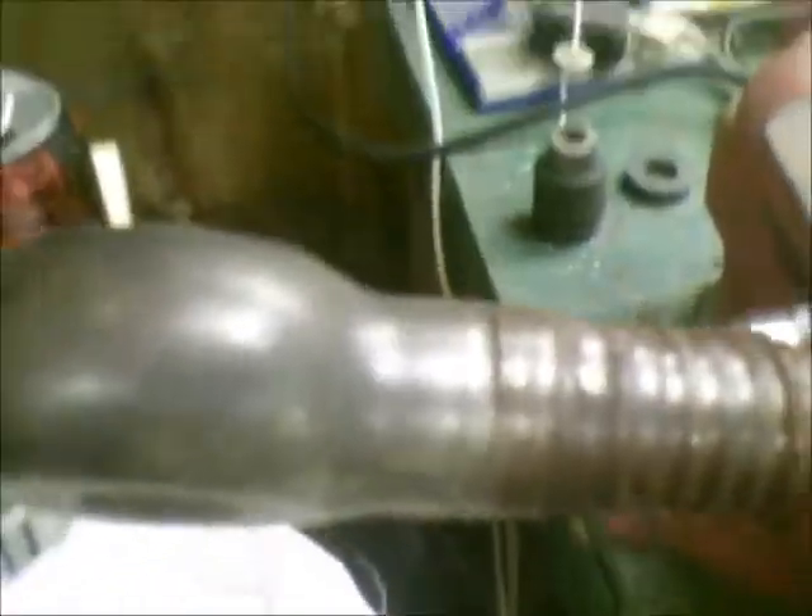As a result, you can kind of see where it is worn down right there. That is a direct result of these caps getting dried out inside, either losing the grease or not having enough grease in them. And that's what caused the squeaking on the front end of these, among a few other items. But this was one of the most notorious.